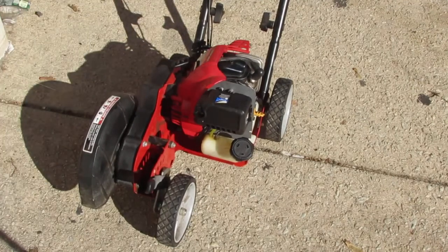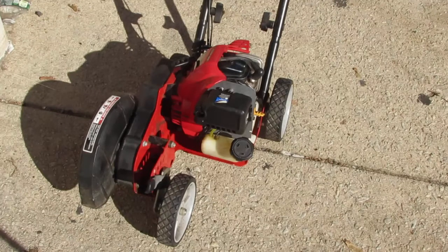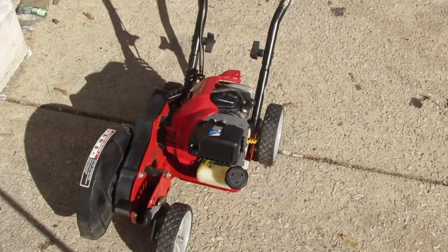So I don't really fully like the little bogging down. It's better. It's running now with no choke, right? So let's pull that carb off again. We're gonna do maybe like a full turn. No, let's do like a half turn, put it back on, so we can see how it behaves. Yeah. All right, let's see what we get.